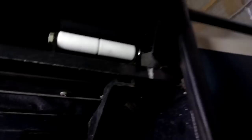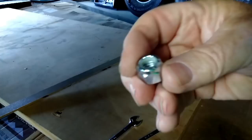This is on the living room slide. We'll show you the bedroom slide — it does not have this flaw; it's done correctly. We may have to take some molding and rubber off the kitchen slide to see if it's the same way, but we'll get around to that. What we're going to do is replace this nut right here — which, by the way, when I went to loosen it, it was already loose and starting to come off. We're going to replace it with the same size nut but with an insert nut, so it'll stay on there and it's a lot smaller. It does not have that big edge, and that should take care of it.